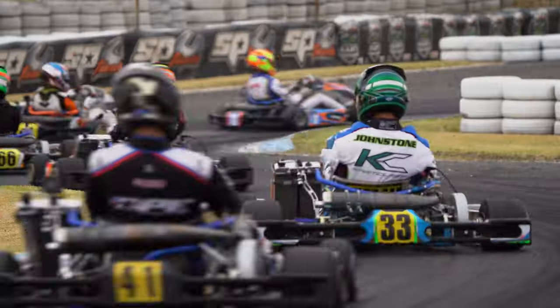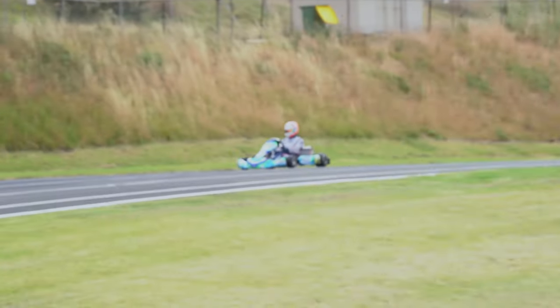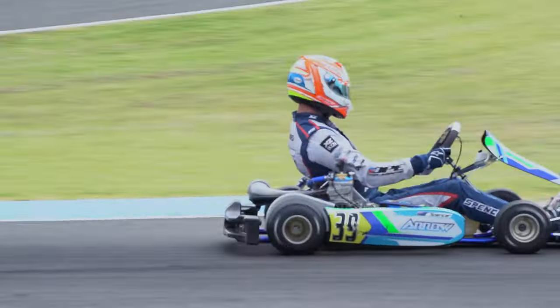The second point is car setup. With a soft compound tyre you need the setup to be more forgiving, more free, more slippery. On hard compound tyres you might run a softer axle, the rear track a little bit further in, or more caster to generate more grip. But if you've already got grip dialled into your kart and then bolt on a softer compound tyre — especially a fresh soft tyre for qualifying — the kart can start to bog down out of corners, or feel very heavy in the steering wheel, like you're having to manhandle it to turn.